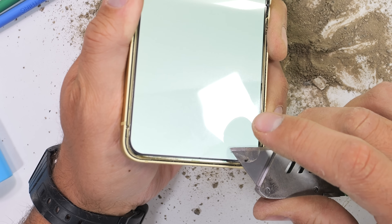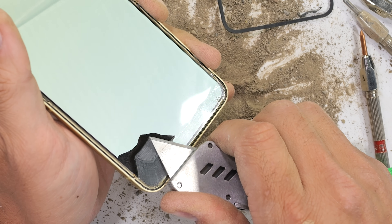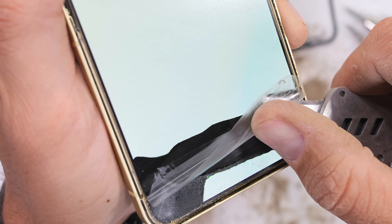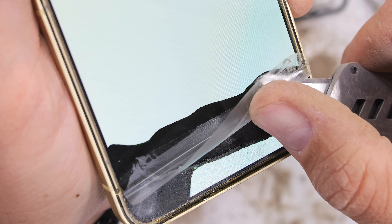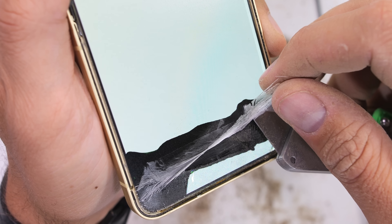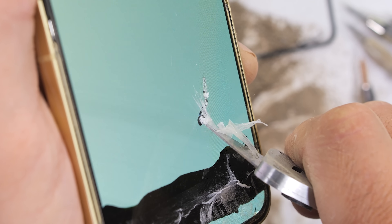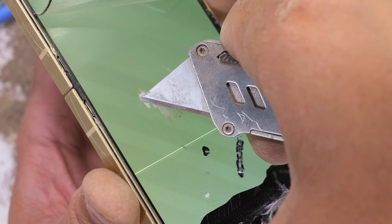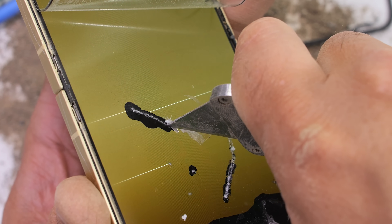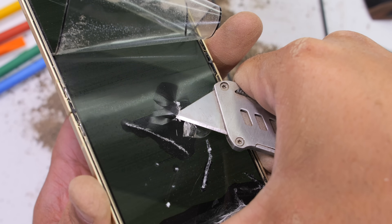The next plastic layer is a very much more permanent layer — this one might be the cured sheer thickening fluid layer, since right below it is the UTG, or ultra thin glass. UTG is a super innovative material that Samsung has been using on the Google Pixel Fold as well as the Motorola Razr phones. Samsung is the top dog when it comes to flexible screens, which is why everyone else is using it. You can see the flexible glass reaches breaking point and shatters as I pull it away from the pixel layer — the glass shards are still clinging to a gluey laminate, and it's most definitely glass. Once the AMOLED pixels are punctured, they go inky black and do not recover.